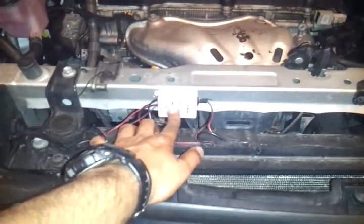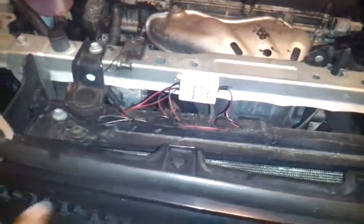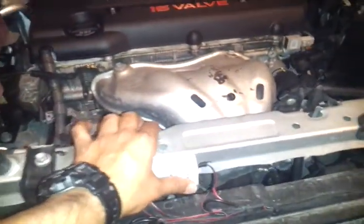I just put a DRL light a couple of months ago and it's from China, but the only thing is it didn't have a delay timer. The problem is I was losing the lights because of the jerk every time when I cranked my car. If there is a delay relay, it usually turns the lights on after a few seconds and that's how your lights are saved. That's why I was looking for a delay relay or delay timer aftermarket.